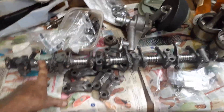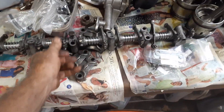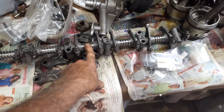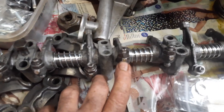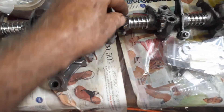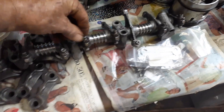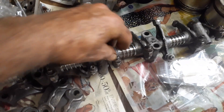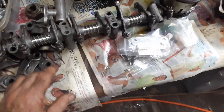These are the parts, and I got the rocker arm shaft back together. I had to chop it in pieces to get it apart. I put a new shaft in it, new springs. And I had to drill these plugs out right there in order to get these adjusters out — they were locked up, everyone was frozen. And as you can see, you can turn them now. But I had to take everything apart. Just one mess after another.